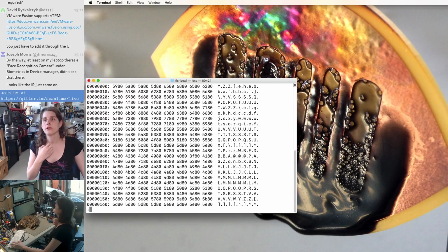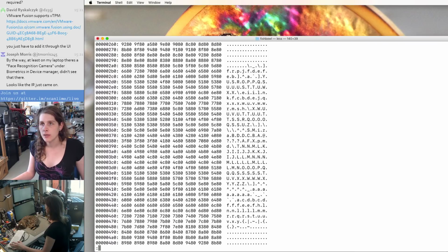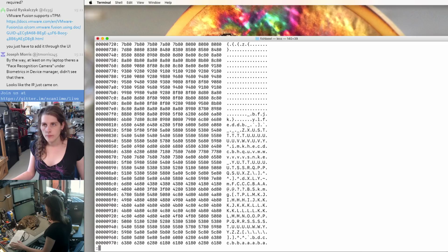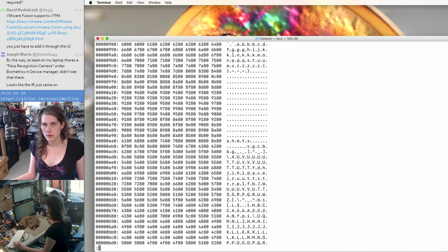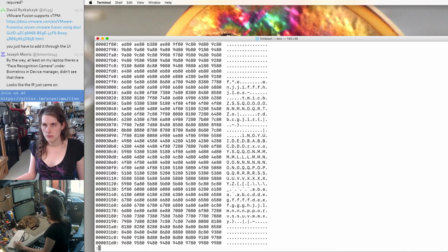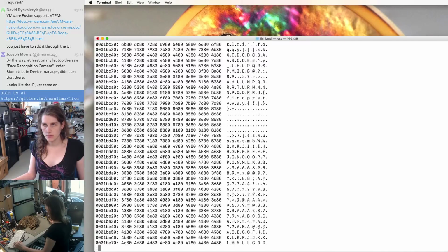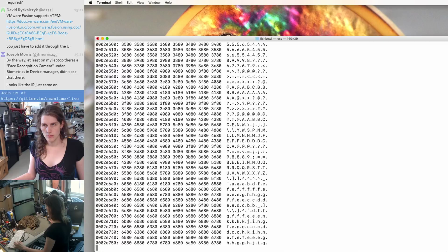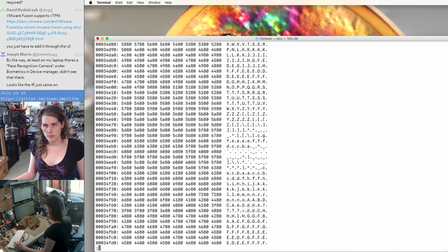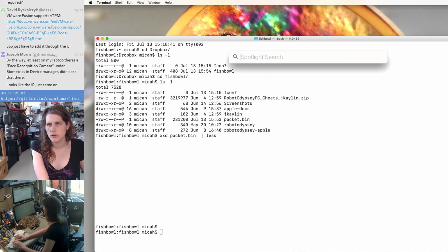This is the file we just saved out of the Total Phase software. So this isn't just a single isochronous packet. This is maybe a frame. There are probably some per packet headers that we would need to strip, although this is not looking like it starts with a header. So actually it's looking like it might be grayscale data the whole way through, which is interesting. I'm expecting those little 12-byte headers to be in there still. It's weird.